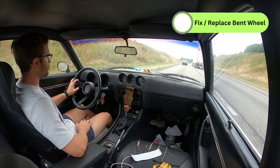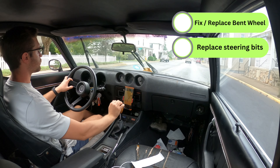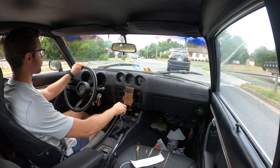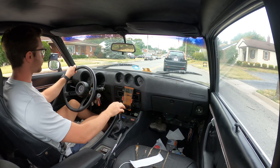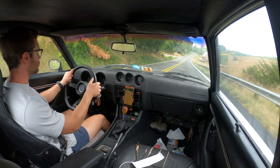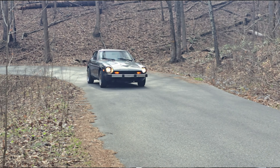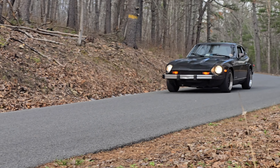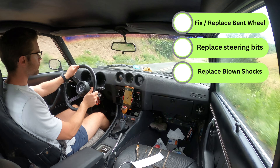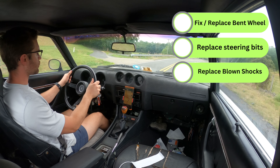There's also a little bit of on-center vagueness, probably because everything rubber on the car is still original. The rack bushings and steering coupler are known to cause issues on these Zs, so I have replacements. Over any bumps or construction the suspension is super harsh — over a set of train tracks it just about rattled my teeth out. Low profile tires probably didn't help. On the rural back road and in the twisties, this is where the 280Z really belongs. Without power steering, everything feels really analog and direct. The car feels really light going through corners and stays pretty flat. The front suspension is really firm but not in a good way, and the rear is a little softer but still doesn't feel like it's doing much dampening — I have a feeling that the shocks in all four corners are blown. Overall it's awful on the highway, fun in the twisties, and if you ever find yourself on a gravel road, your teeth will fall out.